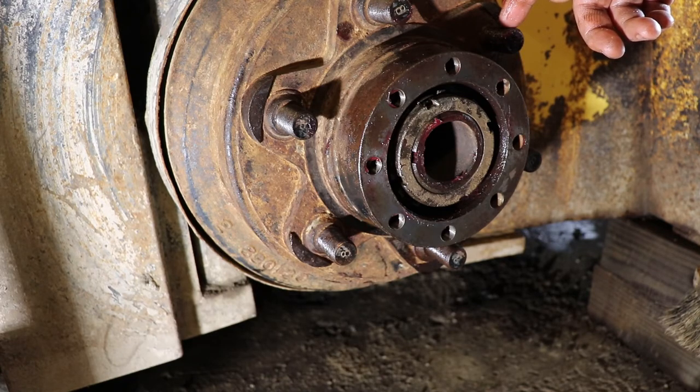You might need a three-quarter inch torque wrench or a really heavy-duty half-inch torque wrench to reach 280 foot-pounds. Once it's all fully torqued down, that is when you bring the air pressure up in the tire - up to 100 psi. Thank you for watching.